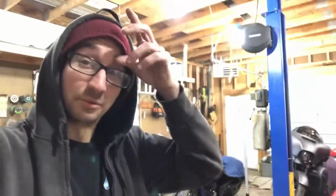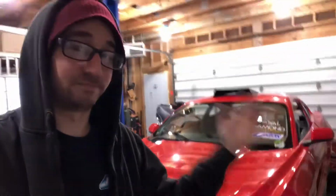Anyways, that's going to be it for this one. I just wanted to show you guys the little single wiper conversion I did on my Mustang. It's not really anything super crazy like building angle kits or turbo kits or something like that, but to do something like that right, custom fabbed, it took some time, and I probably have a couple days into actually doing that, just on and off, taking little breaks here, thinking stuff through, figuring out how to control the wiper speed without actually having a pulse width modulator on it, because that stuff's usually controlled through the BCM, and I'm not using factory plugs or anything like that on it. I had to go right to the electric motor in it, so just little things I had to figure out, but it's one of those things that we needed on the car, and now it's done.